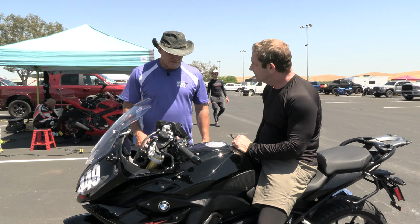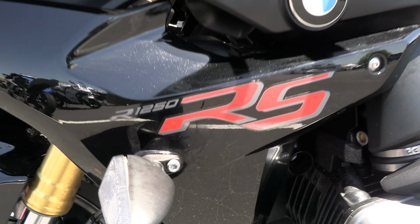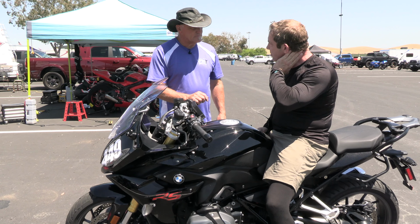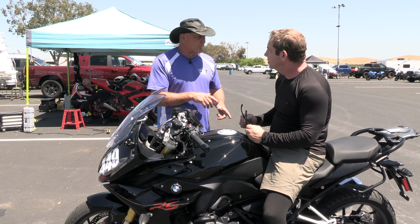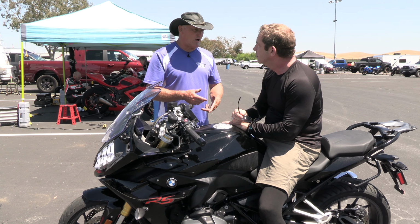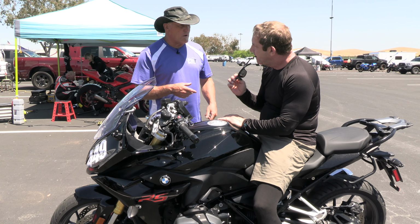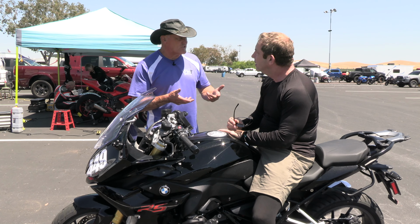Right, no it wasn't. So the first thing we got to do is put her in, and then do some measuring and see, based on the different modes and then the different load settings, what's your absolute minimum value? I think I just have like 2 or 3 loads. It's like minimum, maximum. So we'll go through the dash and look at it. And we'll figure out where, okay, I'm going to ride by myself, this is my setting. I'm going to put a load on the back, this is my setting. I'm going 2 up, I'm really going to load up, I have to do this. So we can at least evaluate what you've got. You might only be able to take a light load and you're tapped because the spring that you have is too soft. So there's good information we can gather.